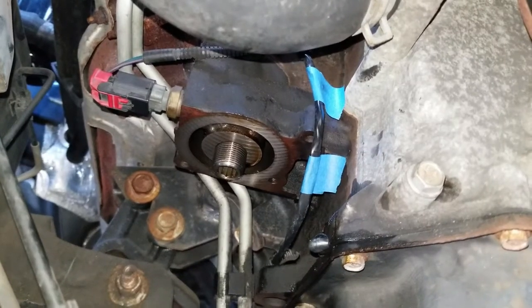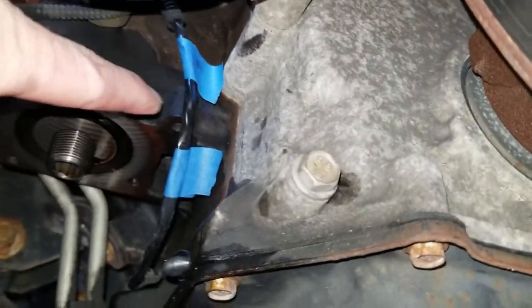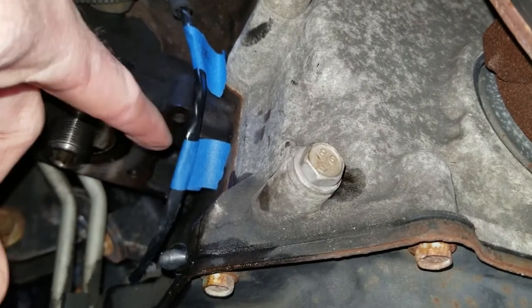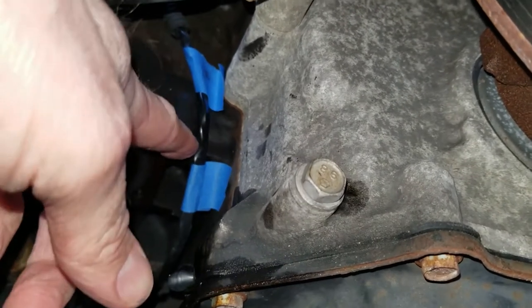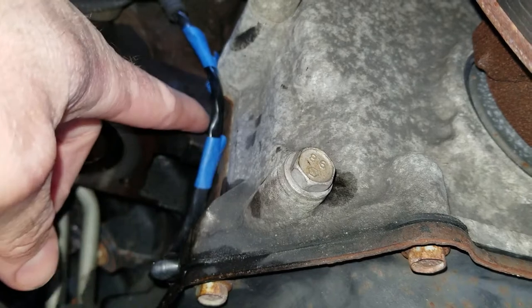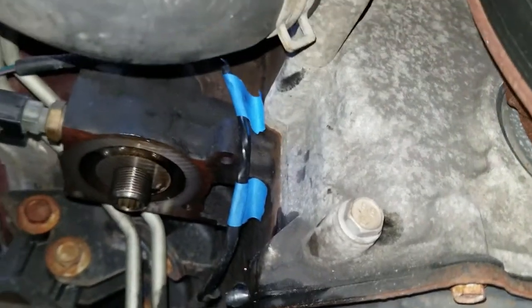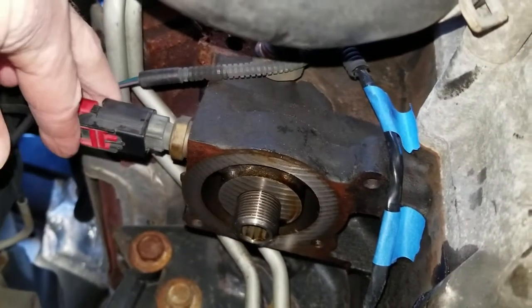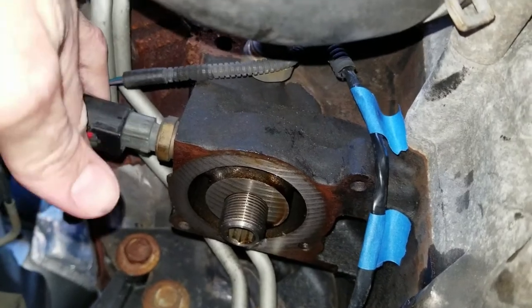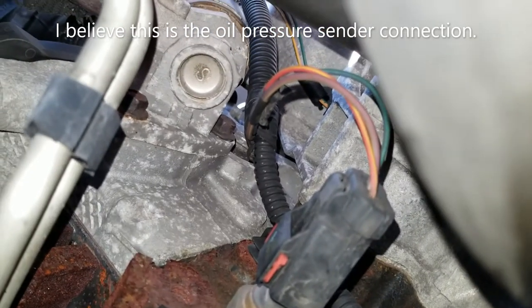You can see I've gotten the oil filter removed. I went ahead and put a piece of tape on either side of where I think the issue is, just so when I pull this thing up from the top side I don't lose reference of where I think the problem is. Putting my finger behind there, I feel like I can feel sort of a nick in the insulation — I really hope there's an obvious problem there that I can fix. Now I just need to fish this thing out. I went ahead and disconnected the oil temp sensor, and it looks like there's one more connector above that I need to remove before I can start working everything from the top.